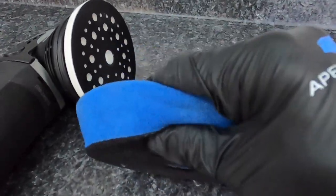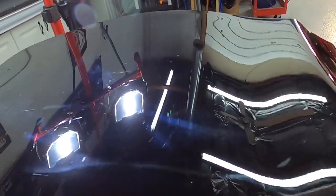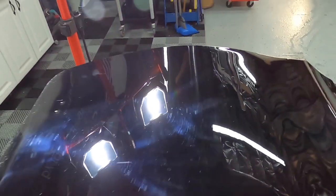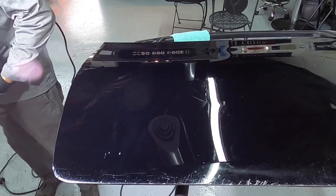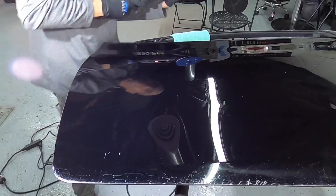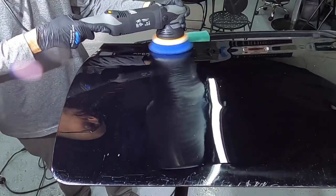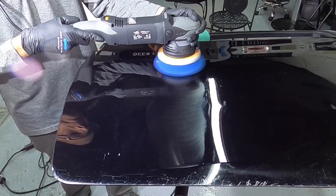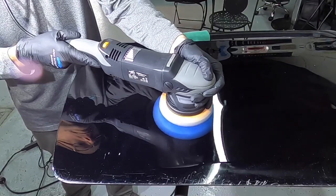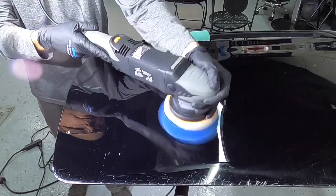Here is another combination: Flawless and a Max Shine pad — just a polishing pad — and we're going to make yet another path through this mess. Improper wash technique, repeatedly running through a tunnel wash, improper drying technique — there are many things that can factor into why your car could have imperfections, spider webbing, scratches, or swirl marks. These are different combinations of how to get rid of those unsightly marks from your clear coat while hardly removing any material. We'll take measurements at the end of both paint depth and gloss to show you the difference we've made without doing any more damage to the clear.